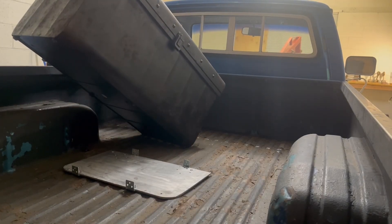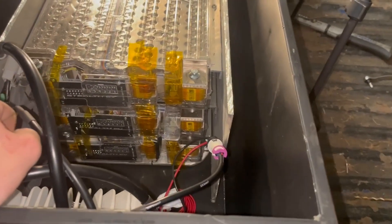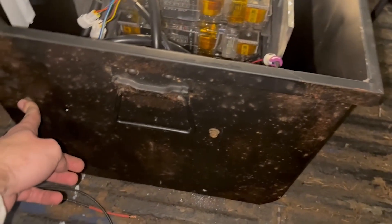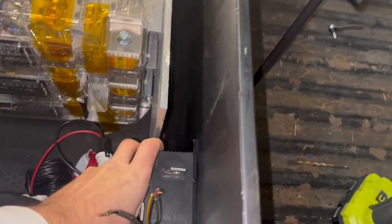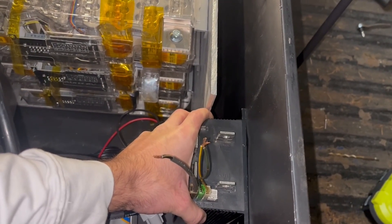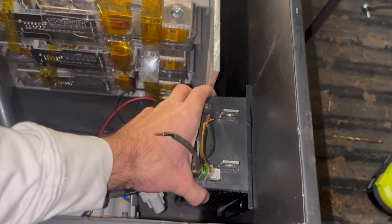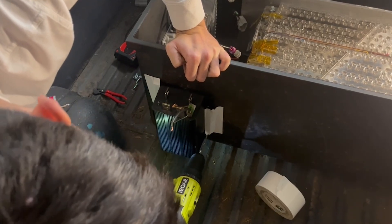I mounted this controller in a vintage-looking metal chest that's through-bolted to the frame of the truck using four 3/8-inch bolts. I might do the controller the same way if I can find more older-looking hardware. I could have the fuse and main contactor up front in a different box — I just don't want too much heat in one space, but I think it would be okay especially if I ventilate it. The chest sort of acts as a heat sink and is vented to allow for some air cooling.